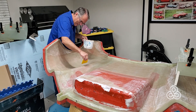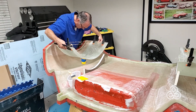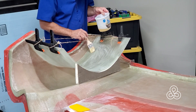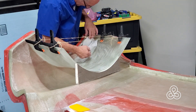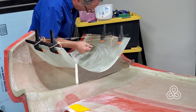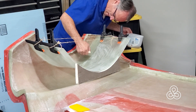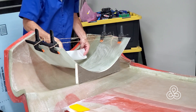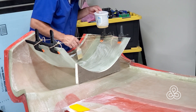Now we bring back that flat panel we created and start bonding it in place. I'm putting a little polyethylene cap from some spray cans underneath it to help hold it so it doesn't fall over — it's all sitting precariously while I do this. The goal is to get a few layers in to bond these things in place so I can do more rugged work on them the next day after cure. I'm cutting some smaller pieces of fiberglass so I can make that bend around the arch of the wheel well more easily — about three sections to get around this bend — and I'll put two layers of cloth on there for a nice strong bond.